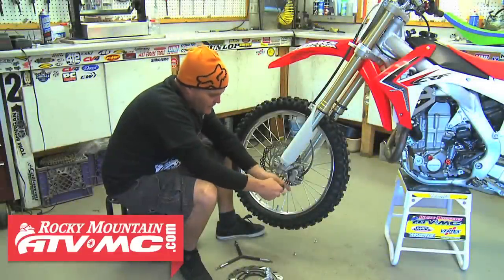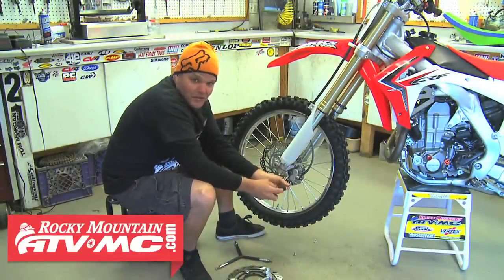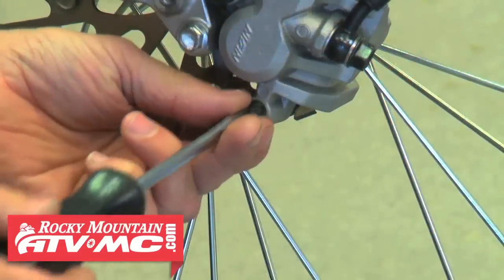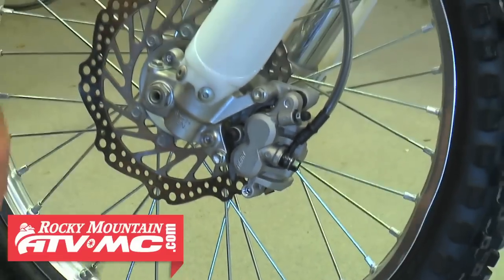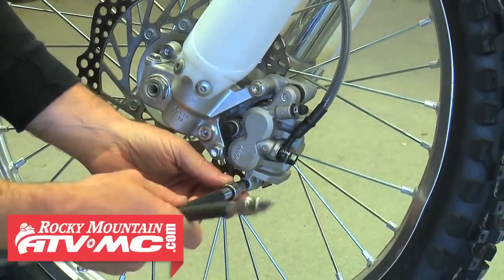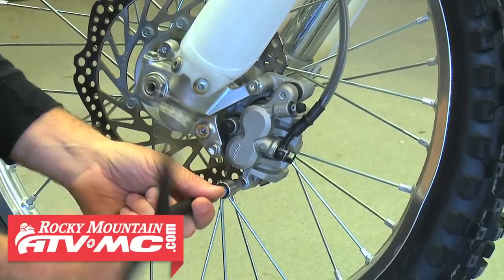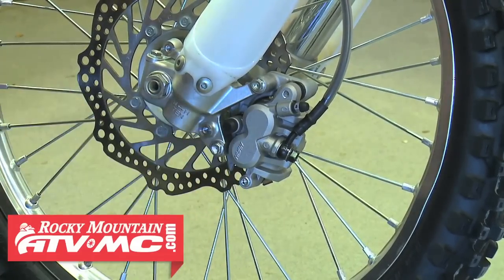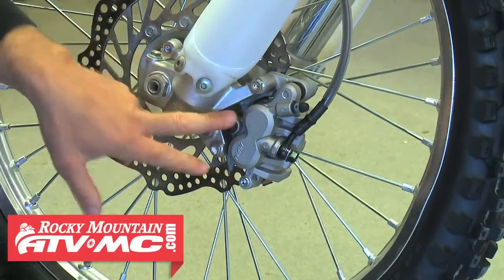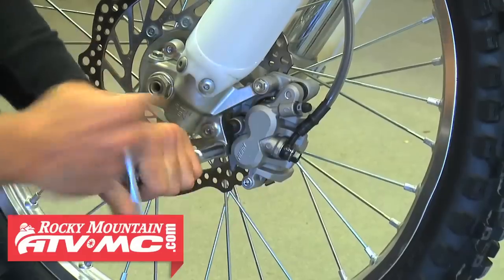There's a little cap right here that gets to the brake bolt — they call it a Lunas cap. I guess Brian Lunas had one of these brake pins fall out one day. Remove this little cap; good idea to keep grease on it so it doesn't gall up. The front brake pin just has an Allen bolt in here. Loosen it most of the way while it's all on the bike so it's easier to do. Then you have two 10mm head bolts right here.